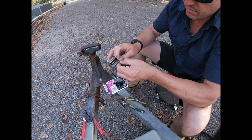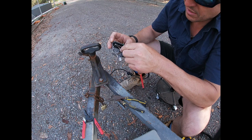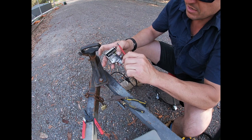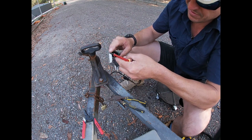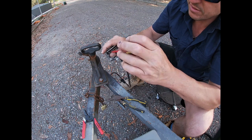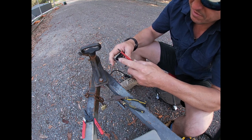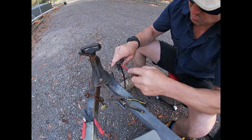Now we've got the red — making sure all the wires are down and tight. Getting the others out of the way, slip that in, hold it to position, and in with the screw. You can feel it — the screwdriver will want to jump the screw, so just don't go bananas. Earth in the middle — that's the white. Then number seven, the tail — near the tail lights. Had a rogue little wire there just making sure they don't touch each other, that's usually the main fault. Green is the other blinker — or turn signal.